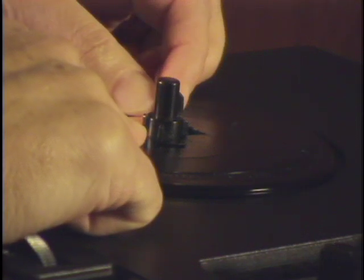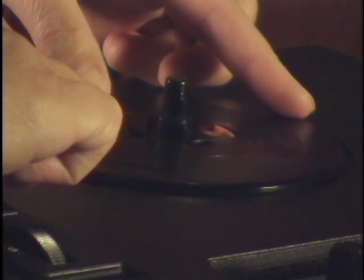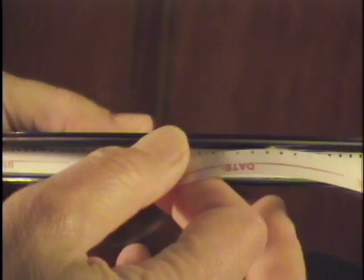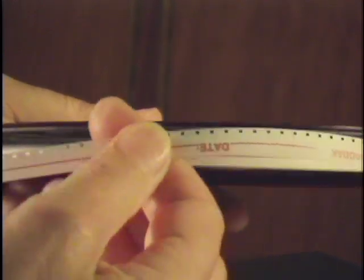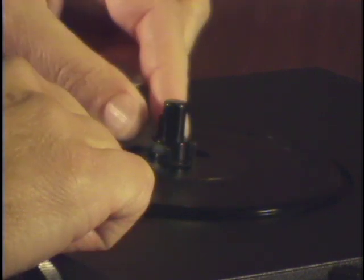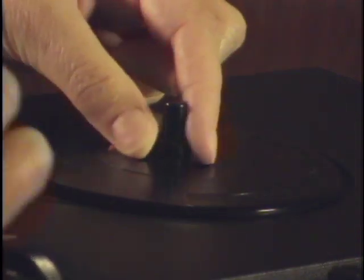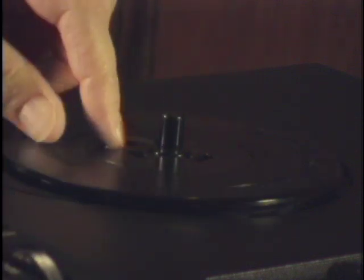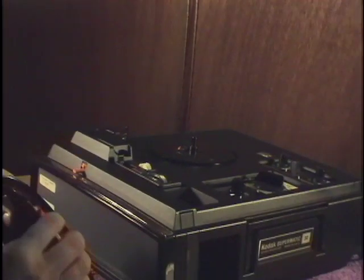The first change is here, and it's actually embossed into the plastic: 'place reel with film perforations up,' meaning in this position with the perfs up, for proper threading. On the other side it says 'spindle' — Super 8 up, Regular 8 down. There are three prongs for the big reel center of Super 8. When you want to convert to 8mm, you just pull this little lever and push it down — it'll take an 8mm roll with its smaller reel center. Pop it back up for Super 8. That's a great feature.